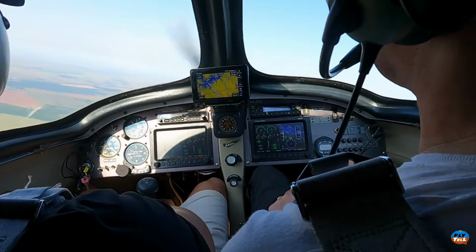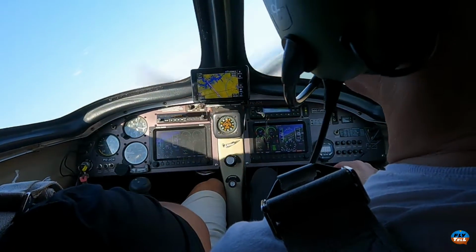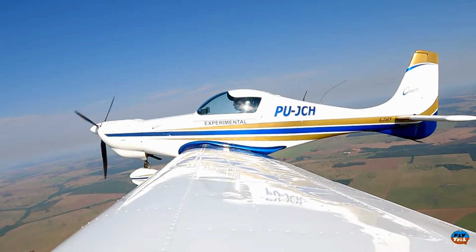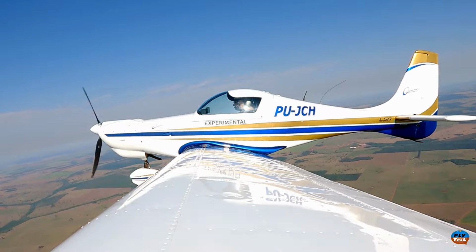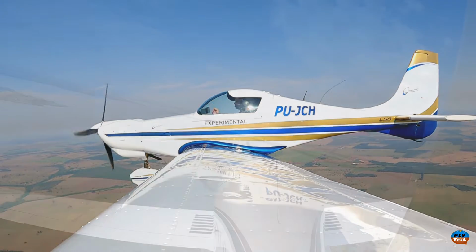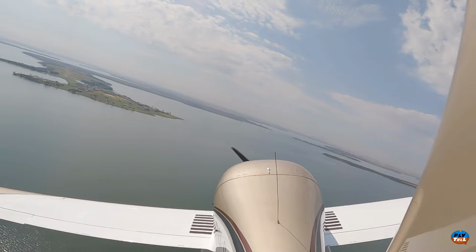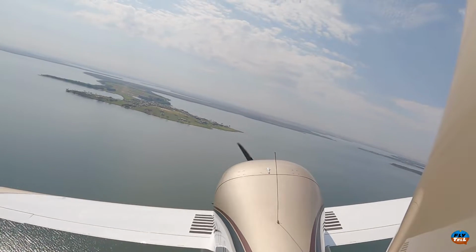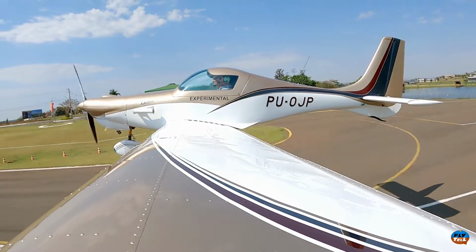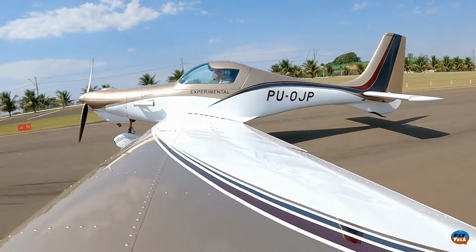As for the Quasar LITE, we were able to appreciate the aerodynamic elegance of the bird with any of the two engines. Control forces are light, notably in pitch, but even at low speeds, it is tame and predictable. In the traffic pattern, the airplane could even use speed brakes. The long, slender wings produce a great deal of lift. And because it sits low on the ground, any excess speed on short final will be transformed into floating when over the runway.